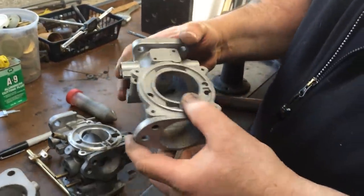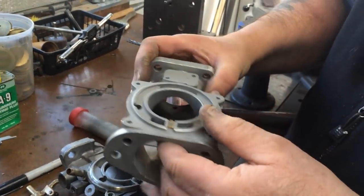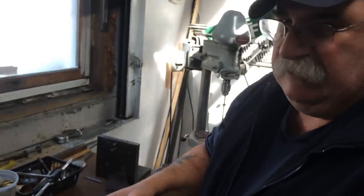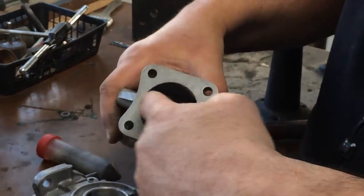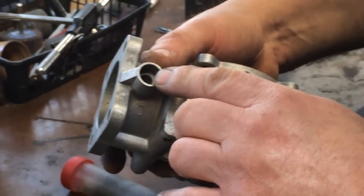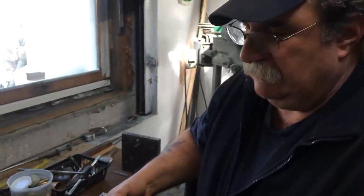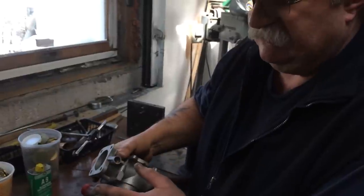The next carburetor is called an HD, and that's because the jet assembly had a diaphragm on it. These were used on Healey 3000s, early Healey 3000s, XKEs, Mark II Jaguars, and on and on. In the two-inch version — referring to the butterfly — you could possibly have three different bushing arrangements. You could have a brass bushing that fits tight to the shaft. You'll see those on XK150Ss and all the time on the inch-and-three-quarter version, which were on the Jag sedans.